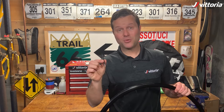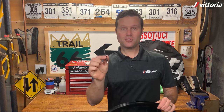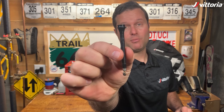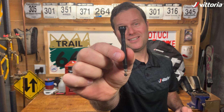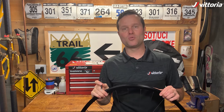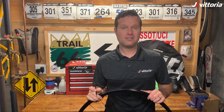In this video, we're going to go over how to install a tubeless valve in a tubeless ready wheel. The valve itself looks like this — it looks a lot like a Presta valve from an inner tube, except obviously the tube's not attached. You're also going to notice that it has a special conical base, which basically forces itself down into the valve hole in your rim and prevents any air or sealant from escaping from the airtight system.